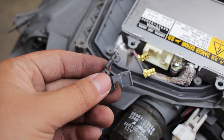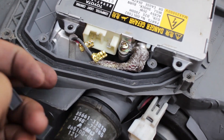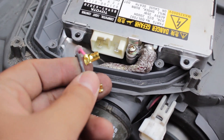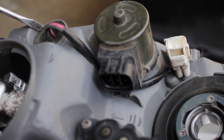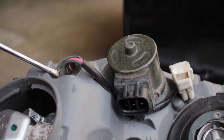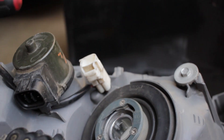I got the little plastic cover right here — just slip a flathead along the line and pry it out. It's pretty easy. This lip just holds the connectors in place; you don't need to do anything hard to take it off. These are the wires I'm going to splice, but first I'll take them out of here. To take them out it's basically just a rubber grommet — get a flathead and bend it so you can pop it open and lift it out.